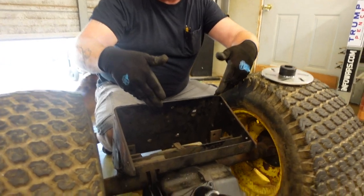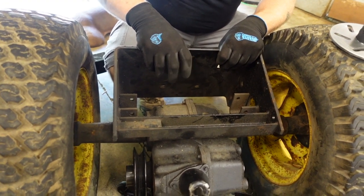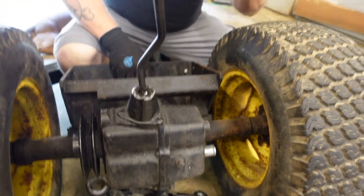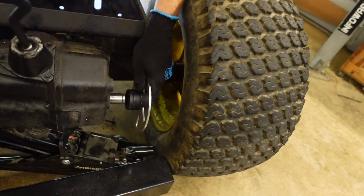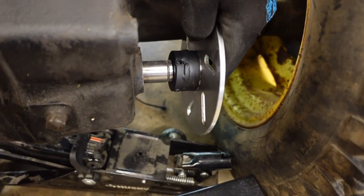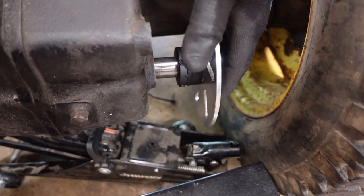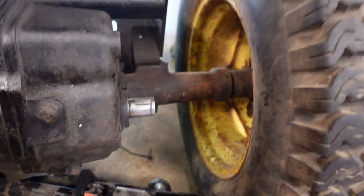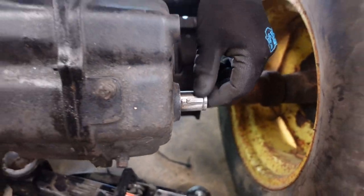This episode, if you notice, we took the transmission out — dropped it out, it's bolted to this frame member on its own and free of the tractor — because I had to modify this brake disc a little bit. In a previous episode when we installed this Go Power Sports disc it worked great, however when it was all the way on the brake shaft for it to be inside the caliper correctly, it didn't engage the keyway all the way — there was maybe about an eighth of an inch of keyway sticking out.